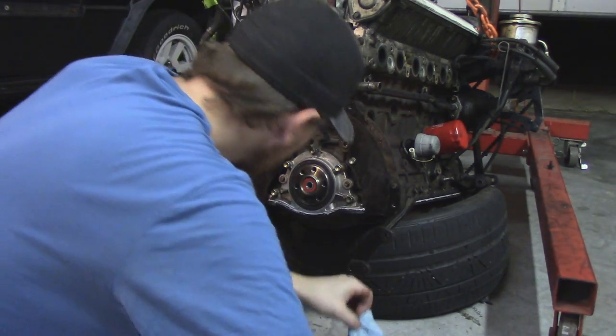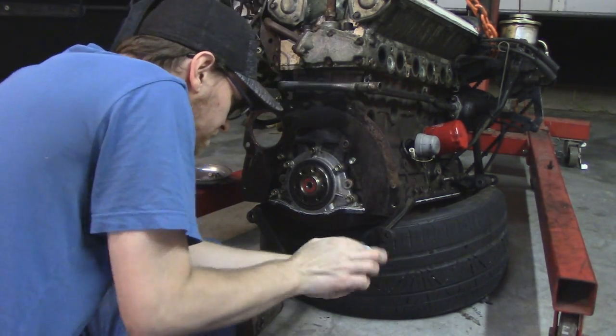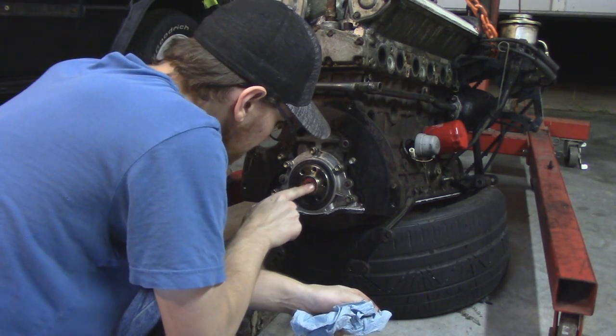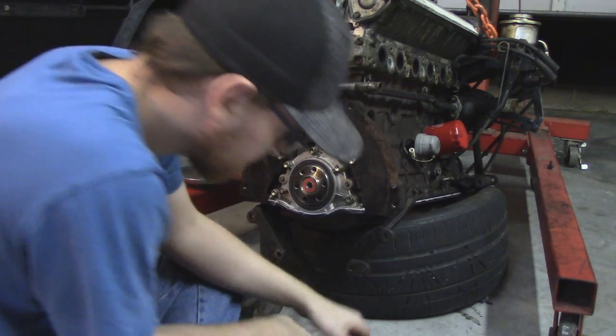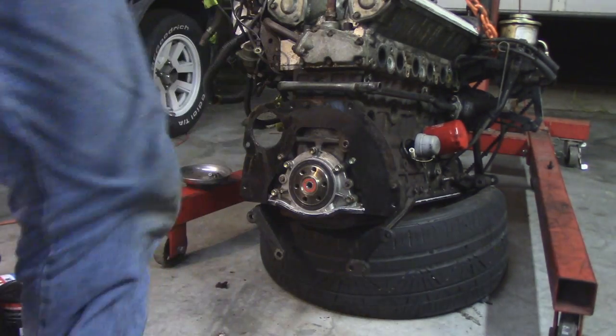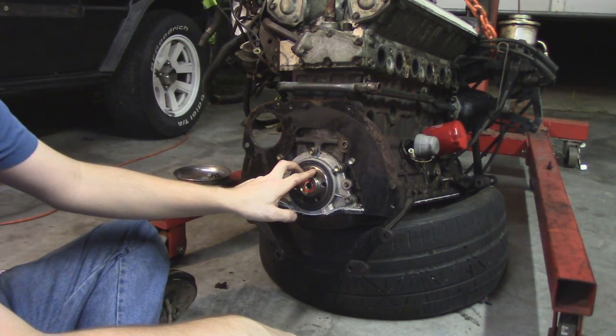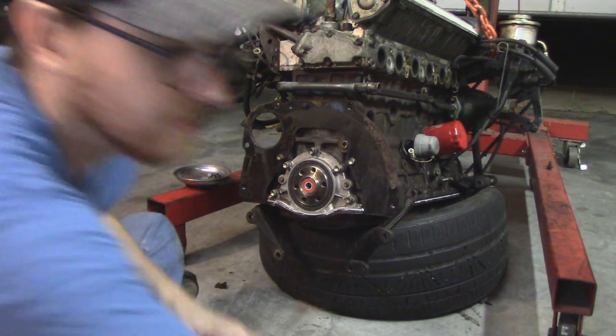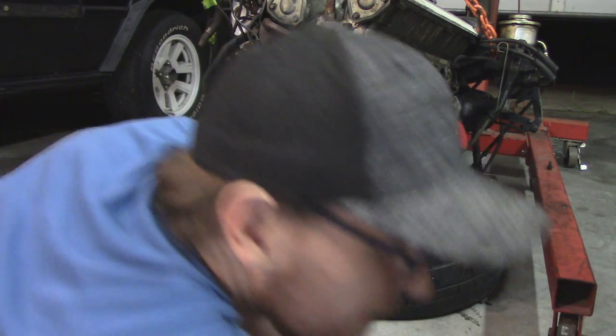In most cases, it's a bushing, like a brass bushing, that is an actual wear item, and as it wears down, it lets the input shaft move up and down too much and causes damage to the transmission. So, like I said, if you're doing a clutch job, go ahead and do the pilot bushing and the pilot bearing. It's a pain in the butt, but it's worthwhile.